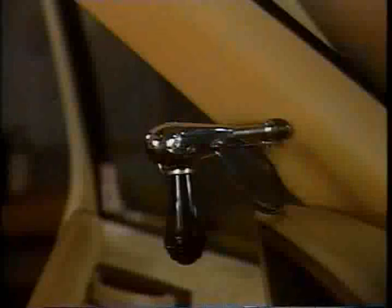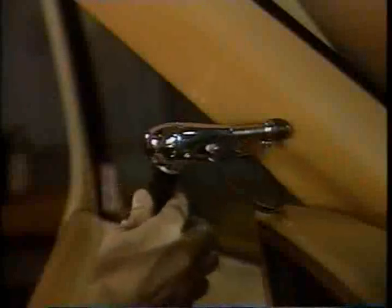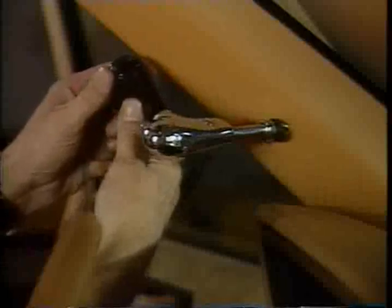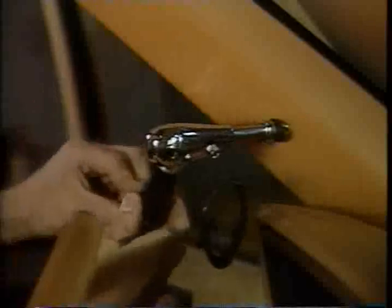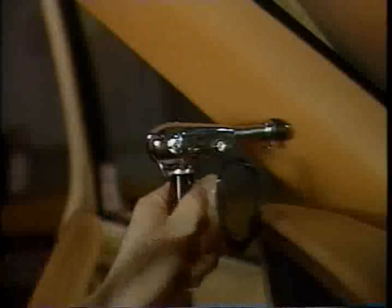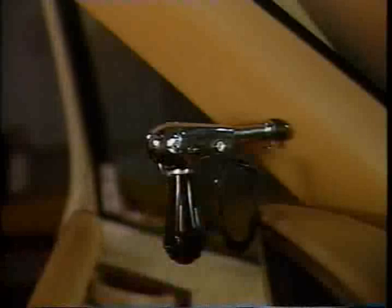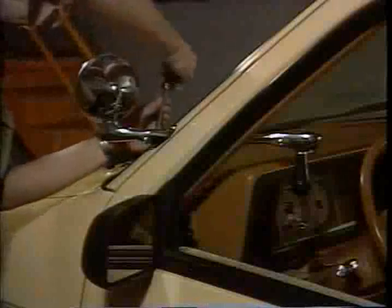To set the handle stop, rotate the handle about the shaft in a clockwise direction until the stop can be felt. Then continue to move so that the outer shaft will rotate until the handle is in an upward position. Slowly rotate the handle in the opposite direction until the stop can be felt. Carefully continue rotating the handle so the stop is moved and the outer shaft is rotated back so that a desired clearance is obtained between the handle and the dashboard. Tighten the bracket clamping screw outside the vehicle.